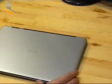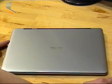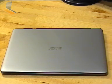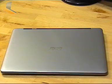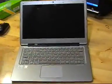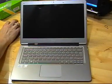Switching to the device — it's completely switched off. This is a 320GB plus 20GB HDD flash hybrid hard drive. The 320GB is exposed to the operating system, and the 20GB gets used in a hidden way as a flash cache, probably in the same way SD cards were used to speed up Windows 7 or Vista. Let's time the turn-on speed from cold to get a feel for what that hard drive adds to the boot experience.